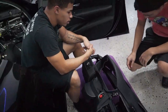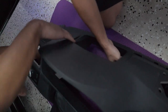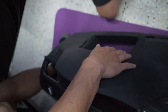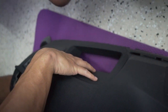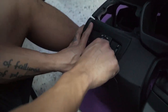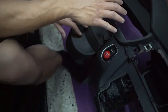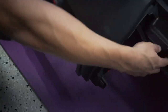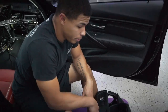Now that we have the old dash out — Ben, what do we have to do? So we're going to move the head-up display trim, mock it up because my old dash doesn't have a head-up display, make the cutout so he can still have his HUD. Then transfer over his lighting switch cluster, the bottom section panel, the switch, and the AC ducts. Swap those over, plus the airbag for the upper portion. Once all that's transferred to the new dash, we'll be ready to put it back in.